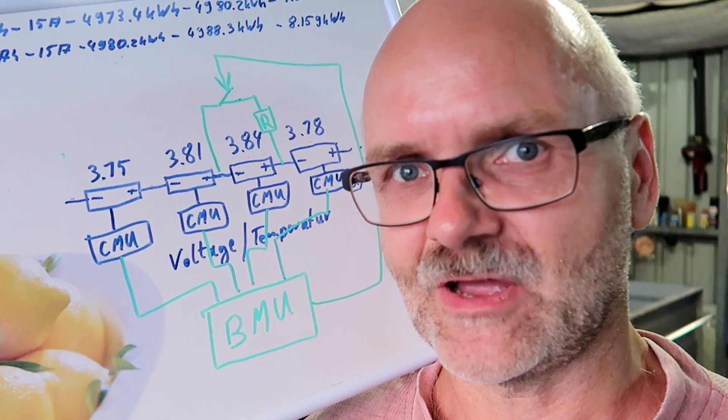There is a big discussion going on in the Tesla forum at the moment. People are saying that Tesla cars balance their pack all the time — not only while the car is charging but all the time. Because they don't have a Tesla watchdog equivalent they can't really look into the actual cell voltages, so it's only speculation. I don't think it is the case, because you need to have a defined state of battery conditions to actually measure the voltage and the temperature. This is most likely being done while the car is charging, when it throttles down the energy going into the battery to about 100 watts — a very low charging speed so all cells have the same condition, and then you measure and decide which cells are too high or too low.